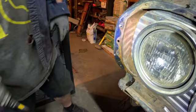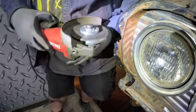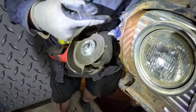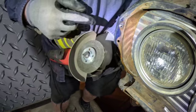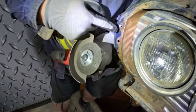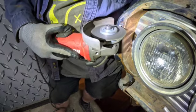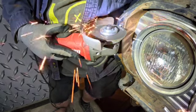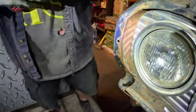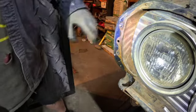All right, and this one here, the head broke off. Not a big deal. What I'm going to do there is just cut a slot in it, use a screwdriver to turn it back in, and then when I take this apart, I'm going to be able to just turn this all the way in to get it out of the nut. That's what's needed. And I'll deal with that later.